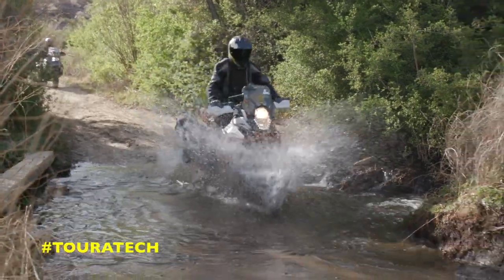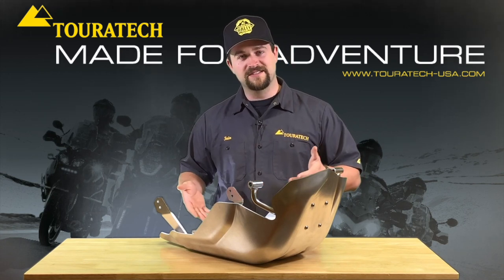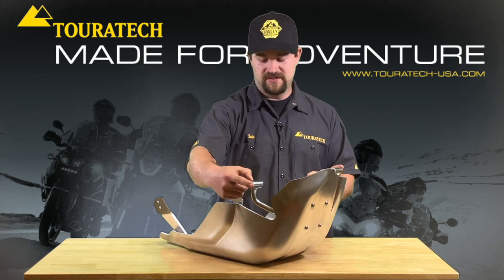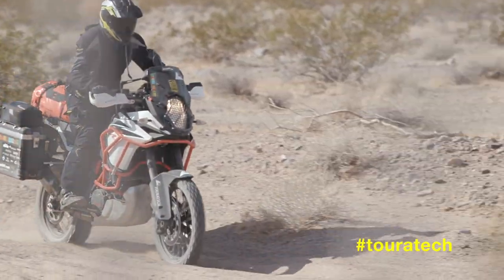The key things that you want to know right off the bat: is it hard to change the oil with the skid plate on? No. Once you've got the skid plate installed, you can drop it with four bolts — two here, two underneath at the bottom. You can change your oil. Easy peasy.